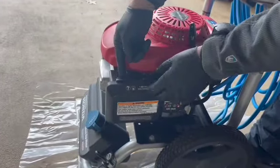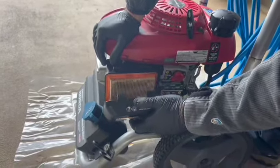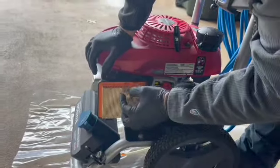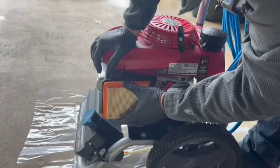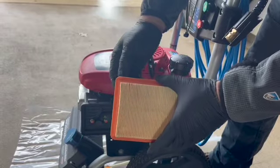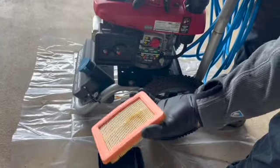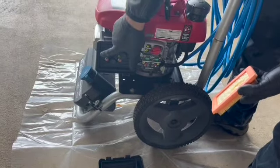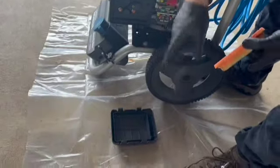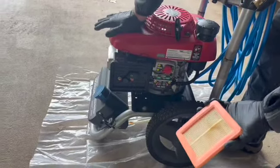You've got these two little tabs on your air filter cover — push those in. It's got a little hinge on the bottom, and it'll just kind of come off. This is our air filter — you can see how clean it is. It's super clean on that side; here you just have a little bit of discoloration, but it's a very clean air filter. If it was dirty, you can use a clean rag in there, or air in a can like an air duster and blow that off.